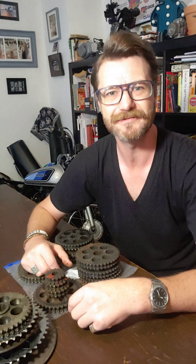From there we have a varying degree of wear. These particular teeth — while they're not gouged on the top, they're very rounded off. See how each one is rounded? That's pretty bad. So if your teeth aren't flat on the surface and don't have an absolute machined tip to them, they are wearing out and are no longer going to do you any favors when you're running down the trail.